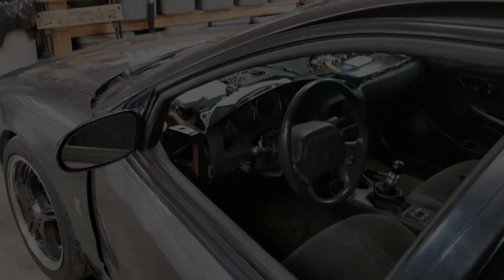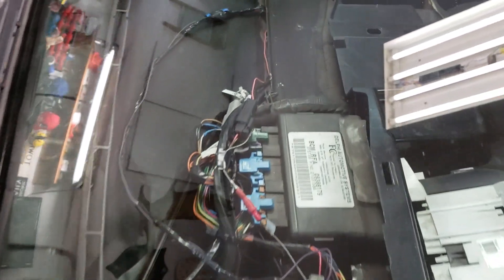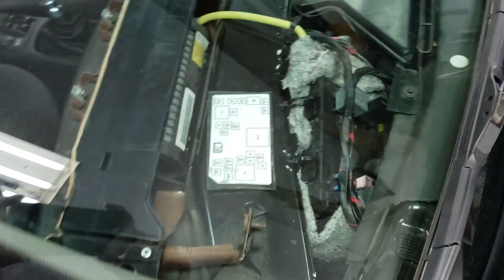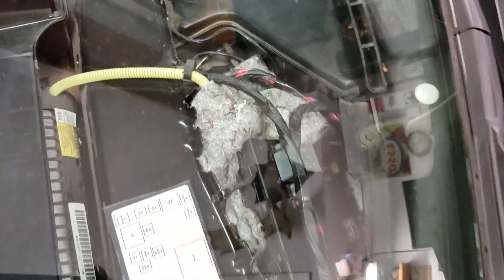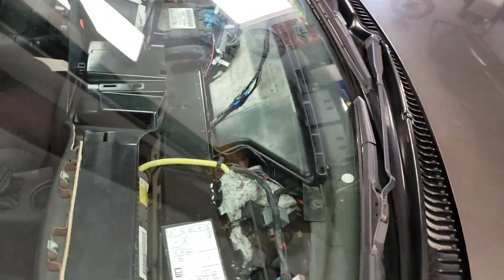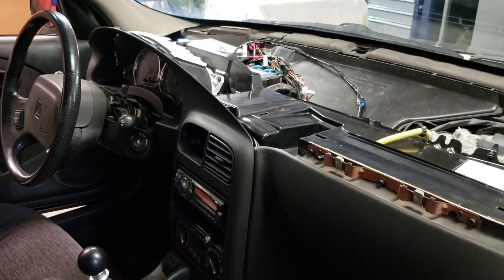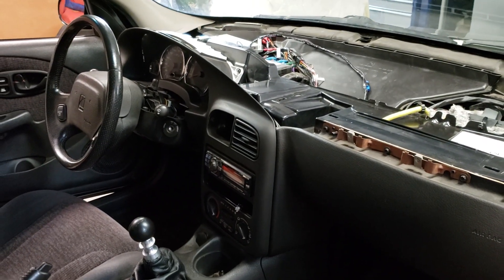Moving on to finishing up some wiring. I've cleaned up the wiring quite a bit. I used these Deutsch connectors as often as I could instead of crimp connectors. Coming around to the passenger side, I used some sound deadening car insulation around the fuse box just to get rid of any rattles. I shortened up all the wires there and tidied that up, so now the dash looks fairly clean. The unfortunate bit is that I'm going to have to pull it apart to do the AC wiring, but for now this is good.